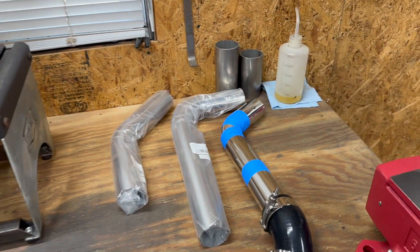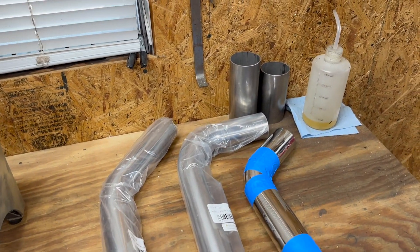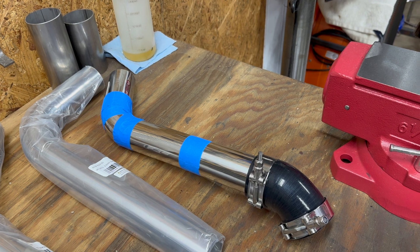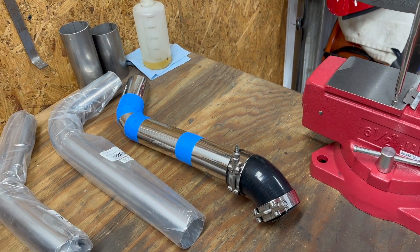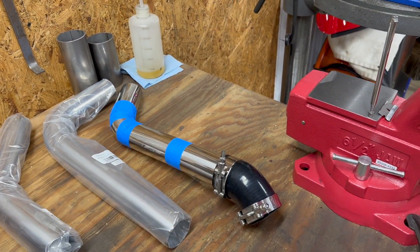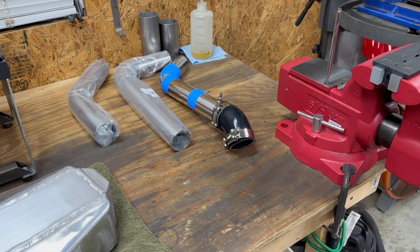I've got a 90-degree pipe here for the outlet side of the intercooler to the throttle body, which should be nothing more than a couple of trims. And you'll see here that I've already got something mocked up for the turbo-to-intercooler inlet connection — basically just a 45 and a pie cut and a couple pieces of straight tubing put together. This hits reasonably well where I want it to go. So once I get the intercooler physically mounted, I'll double-check this pipe, make any final adjustments, and then go ahead and start welding things up. I hope this will be a relatively easy process — you know how it goes, the one-hour job turns into a four-hour job — but let's get rocking on it and see if we can get it knocked out.